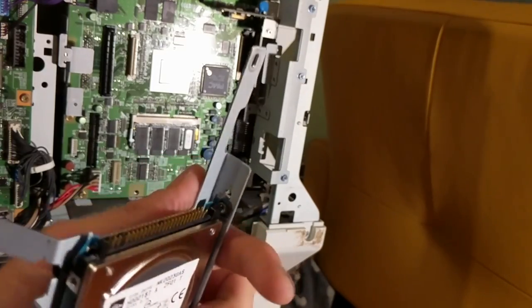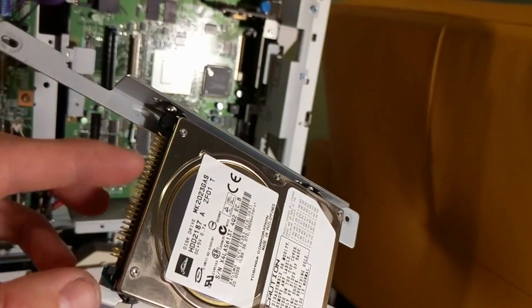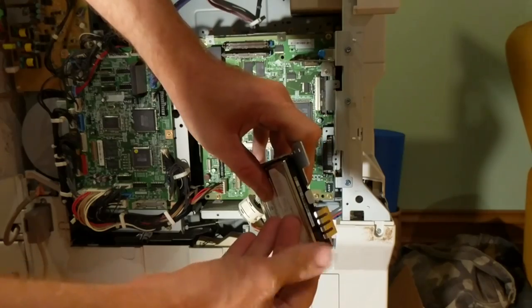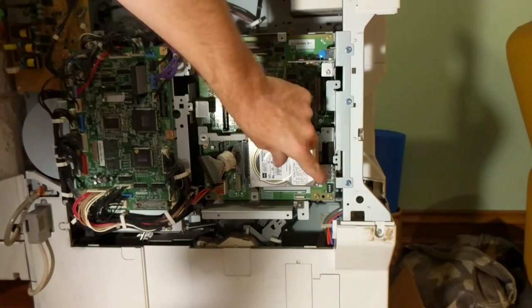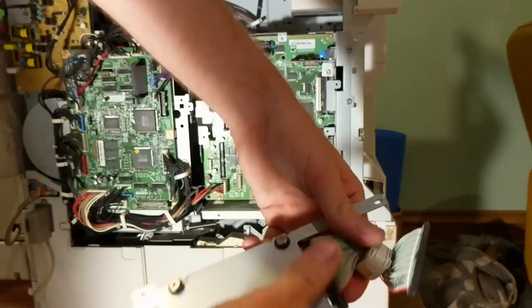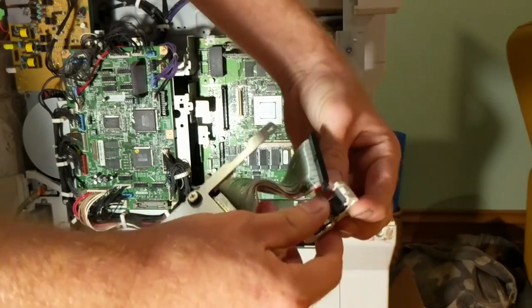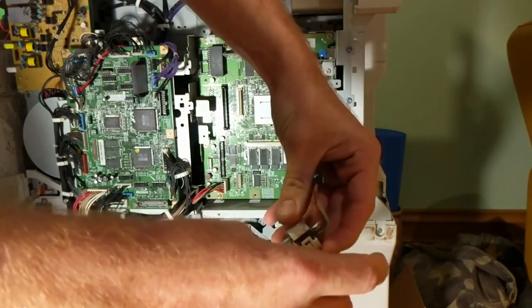It looks like some kind of proprietary interface — or maybe it is laptop standard. The reason I say that is because unlike a desktop drive it doesn't have a separate power connector; it's just a single piece connector for the hard drive. Now there are a couple of things here that are interesting for the younger players. Number one is these little metal fingers that are quite flexible — those are to act as good electrical contact between this cage and the body of the photocopier, for adequate grounding. Also, if you haven't seen one of these before, this is a ferrite core. You wrap this around wires and it generally helps stop signals getting out and other bad things happening with interference. This one you can actually pop apart into two little halves — you can wear it like a keychain or on a necklace if you're a big nerd.